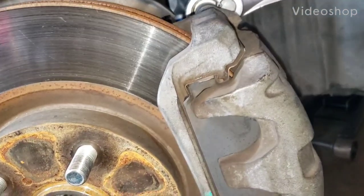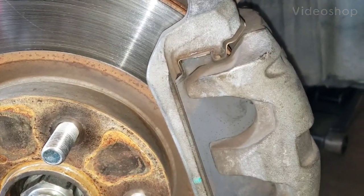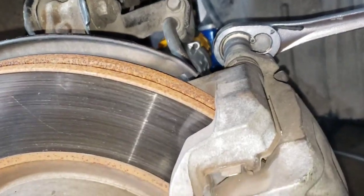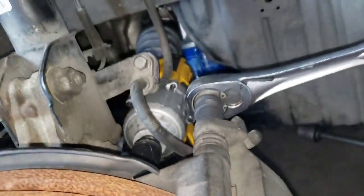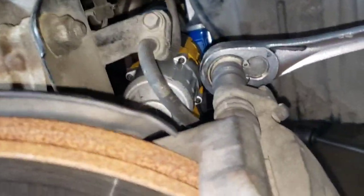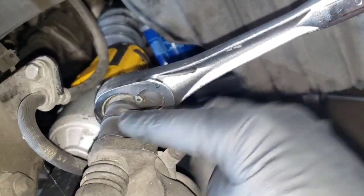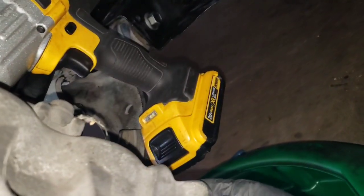So we're gonna replace front rotors and rear rotors on a Honda Odyssey 2011, and pretty much all Odysseys are the same. Hondas too, Pilots. So we got the caliper here. We got two 14s for the caliper, one here and one here on the bottom,